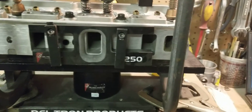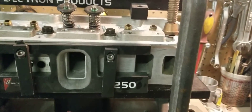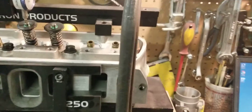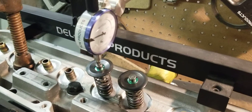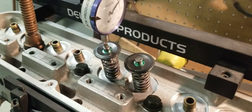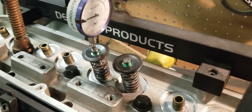They look like they had a little gasket matching, a little work done to the bowls. Not much. We have our spark plug back there for correct testing, and we're going to set these up for 100 thousandths of an inch. So I zeroed out — that is 100 thousandths of an inch — and we're going to see what they do on the flow bench.